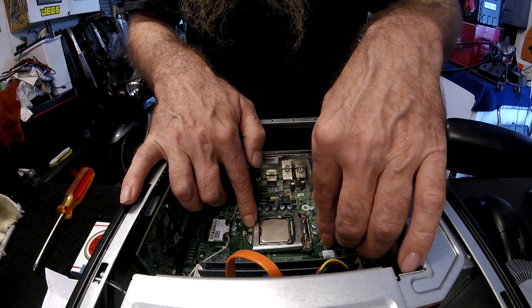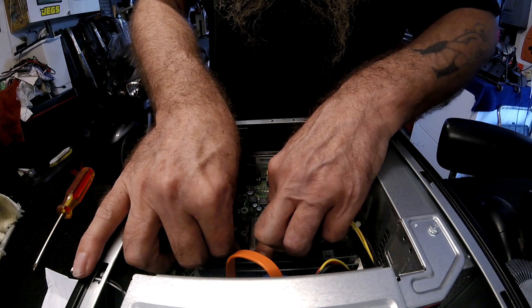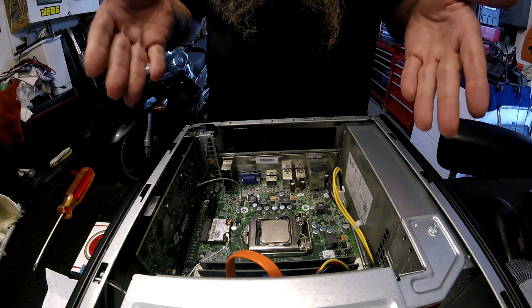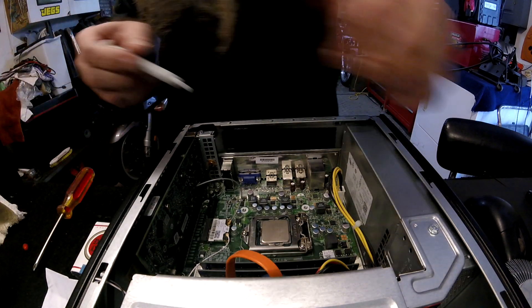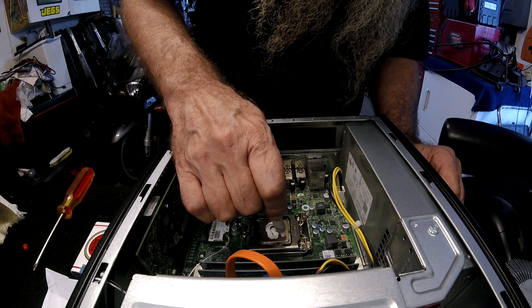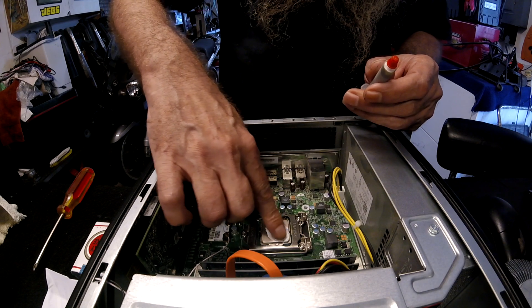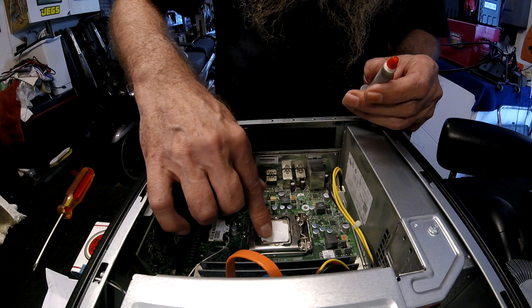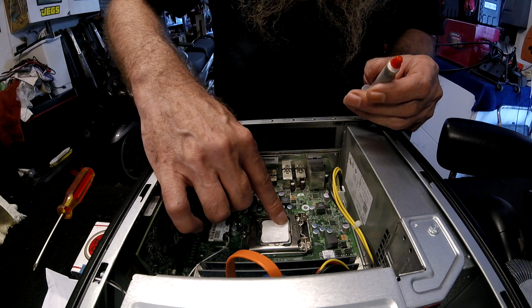This has to slide back to get it under the screw. This is Dell — it's a genuine Intel board, but it's still got that pain-in-the-ass old style clip. Now it's down and has tension on it. I break out my heat sink compound, pop that on there, smear it around, make sure I've got a good coating with no bare spots. It's better to use less and add more than to have a gooey mess for the next guy who upgrades it to an i7 later.